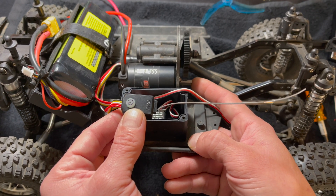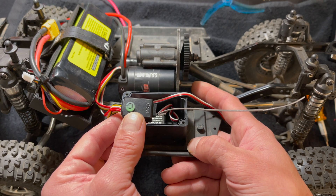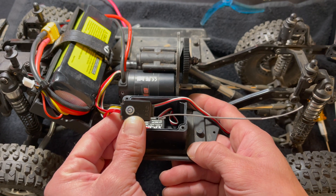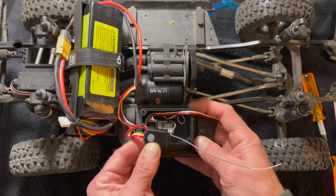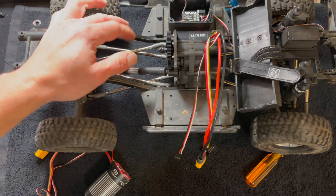It's important not to have any load on the motor while it's doing this. It stops, spools up one time, blinks rapidly, and goes back to red blinking — and that's automatic motor pairing complete.